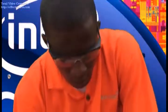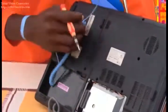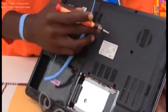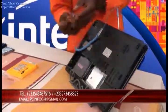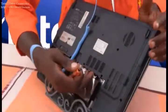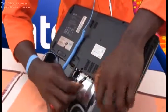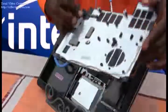Towards this very stage, we have to loosen some screws in order to give us access to the service door. Here we have about one, two, three, and four screws to pull out this very service door. So we proceed by unscrewing. Then we have to change the screwdriver head, and then we try to pry it from this very angle. We pry it out gradually in order to remove the service door. So we move off the service door, and down here we have the service door being removed.